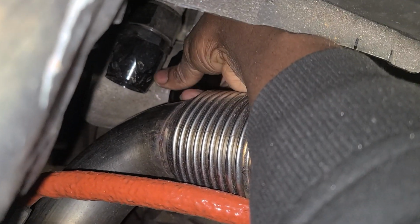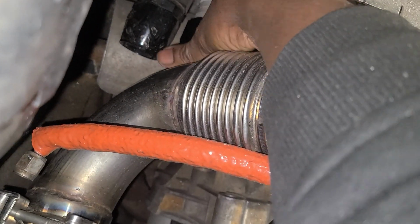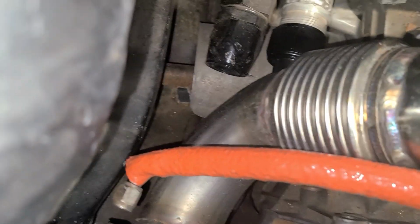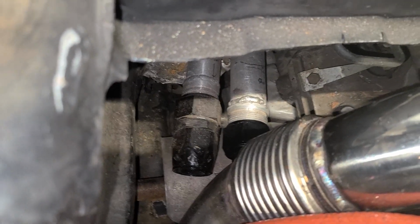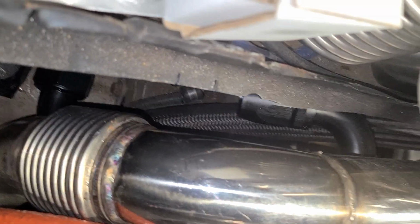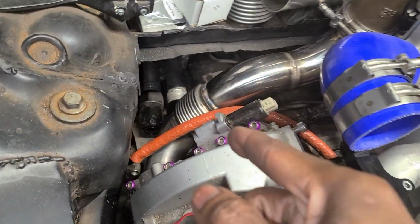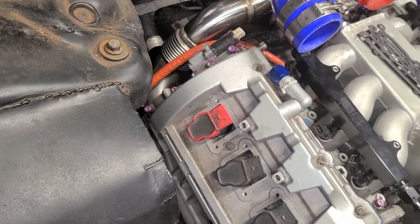So yeah, plenty of clearance, doesn't interfere with the other pipe. The other one is just dirty, it's not scuffed, it's just dirty marks on it from sitting in the elements. So that will go there, and then it will run to that one. Once they're all tightened, the extra piece of dash 20 line you see there will go in between the two, and that will complete the out to the radiator, and then the other one will be in, which runs up to this one in the front, and that will complete my coolant line.